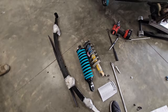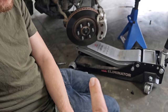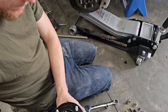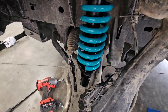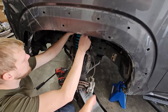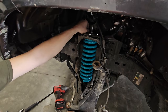Don't try to adjust the strut while it's under pressure because you will strip the threads and your warranty is shot. I'm going to put this on as built. Worst case, after alignment I can adjust it. Before you put these in, notice the little tab on the end that goes in towards the truck — that lines up the bolts and ensures the bottom is sitting the right direction. Come in on an angle, put it up, get your nuts started on top just to hold it, then come to the bottom. You might have to jack up or down slightly to get it around everything, and turning the wheel toward the driver's side gives you a bit more room.